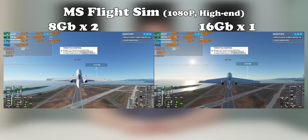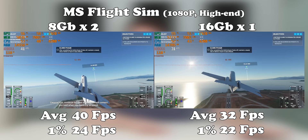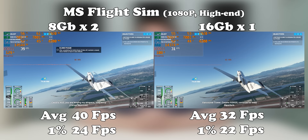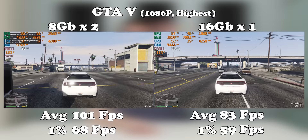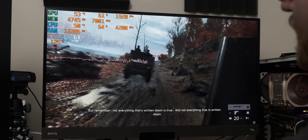Flight Simulator at 1080p also struggled: we got 40 FPS with the 8x2 config, dropping to 32 FPS on the 16x1 — still very playable but a pretty big drop. GTA 5 also lost quite a lot, going from 101 FPS down to 83 with the single 16GB stick. There's a pretty similar performance drop across all these games, and after looking at the benchmarks it's safe to say — as if nobody knew — that Ryzen really likes memory bandwidth.